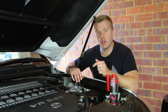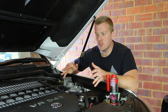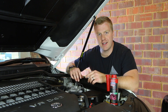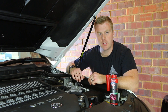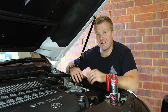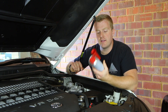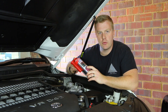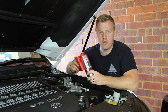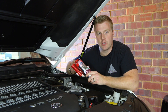Today we're going to be working on a 2014 Toyota Land Cruiser 200 series. The engine in this vehicle is a 4.5 litre V8 twin turbo diesel. So let's start with why we might want to do a diesel purge and what exactly it is. This here is the diesel purge I'm using today — a liquid which is a combination of chemicals and solvents that we inject into the fuel injection system to clean out any built-up deposits left over time.